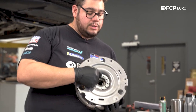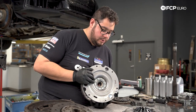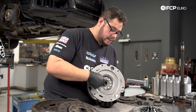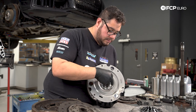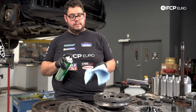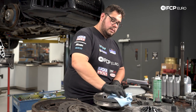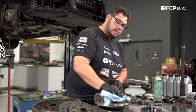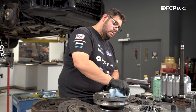You want to get a bearing tool — we're using a universal bearing removal/wheel bearing removal tool that has a bunch of different sizing couplers — to support the bottom of the flywheel mainly around these bolts, so we're not bending or distorting this plate. We're also going to go ahead and clean the surface with some brake clean and a towel. You always want to make sure that surface is spotless before you put your clutch disc on and assemble everything.